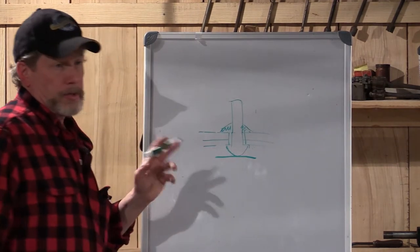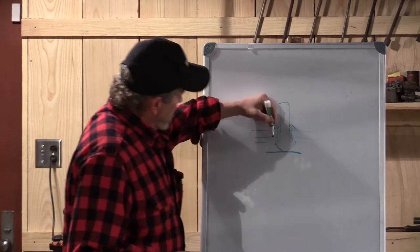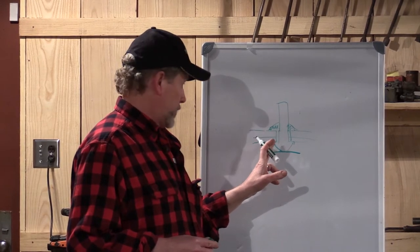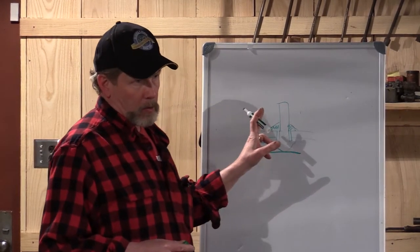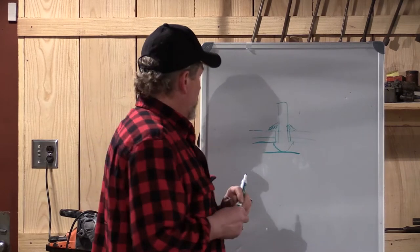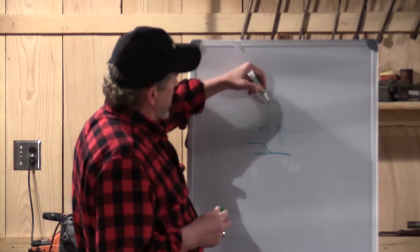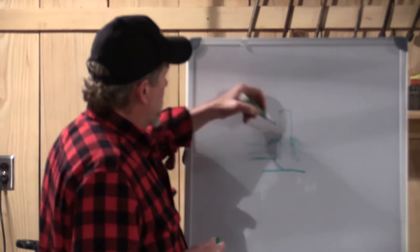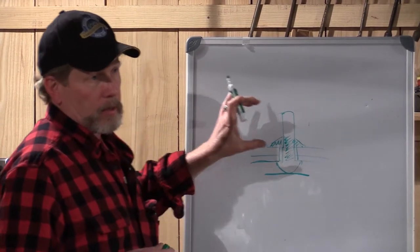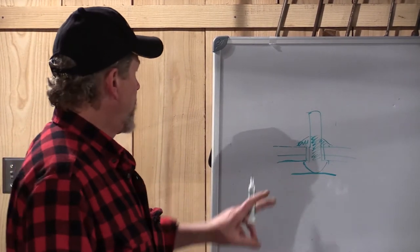You need to do a little preparation to the rivet before and after you set it, but this method has some neat advantages. The rivet itself, much like tinning brass, needs to be abraded a little bit. Chuck it up in a Dremel or a drill and just kiss it with a file or some emery paper to rough it up. Then load it into the hole where the plates are going to be fastened.